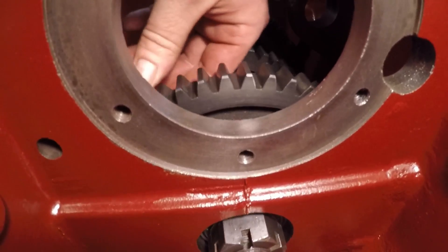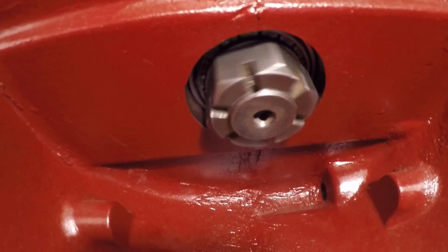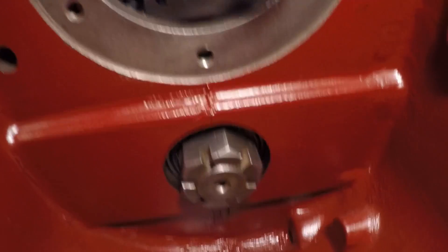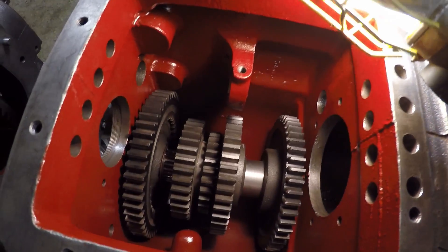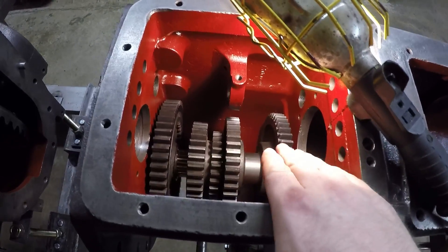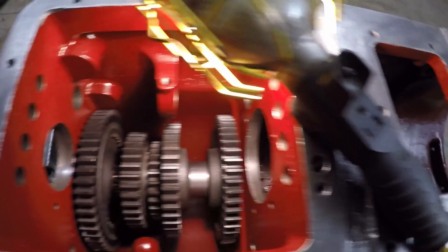As is usually the case with these prototypes, everything's always up in the air — everything's always a question mark. So I'm going to leave that cotter pin out of there for now just in case. I still have a few concerns with this, namely fitting that upper sliding gear shaft through here. It also ties into the torque amplifier unit which runs in this front compartment. I'm once again going to take the conservative route and just leave my options open before I completely tie this down and consider it in place for good. The upper sliding gear shaft is going to go in next in the next video, but that also ties in with the torque amplifier unit — things get very busy and very complicated on this upper axis, so that's going to be the subject of the next video.